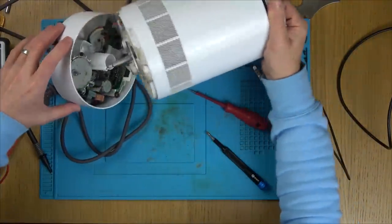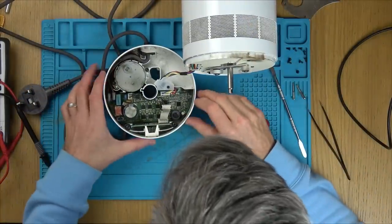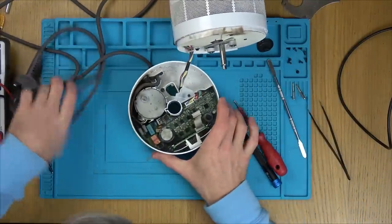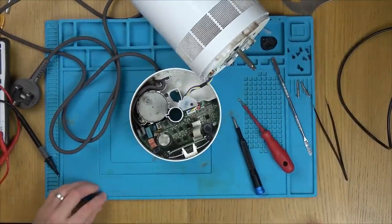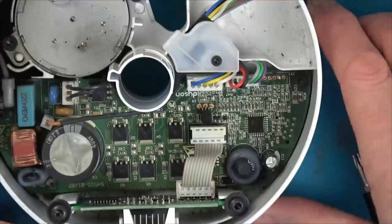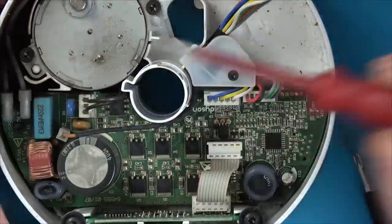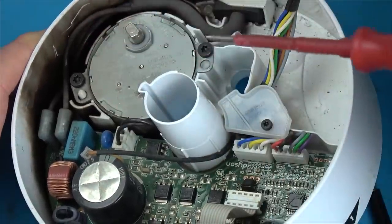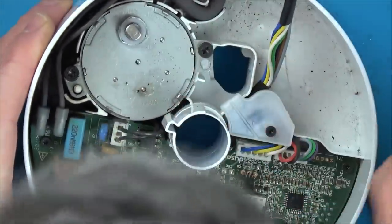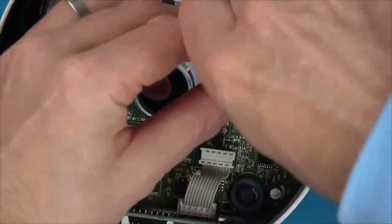I'm just going to reach in and undo the clip holding on the oscillation thing. There we go — that's the arm there. Now look at all this burning here — it's all around here! What on earth. I'm already interested. Let me get my circlip out — now let's zoom in and see if you can spot it before me. I'm getting my hopes up because that was the chip in the last one that had gone. To me the burning all looks to be around a huge area here. The cable's not shorting against anything — but the flames are coming out this way, so it must be something on this side of the board. This is going to be an interesting one.